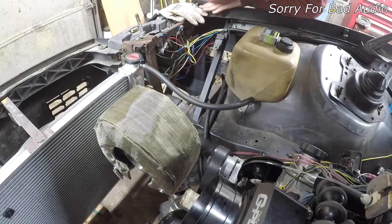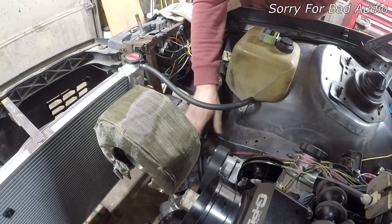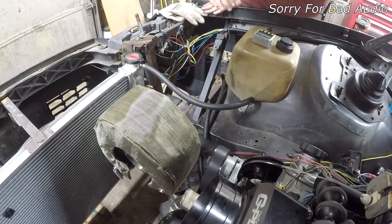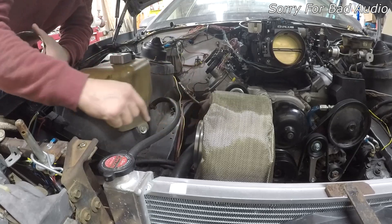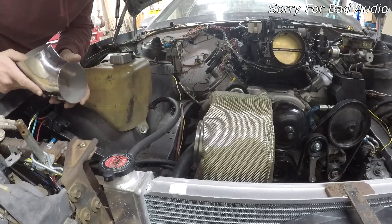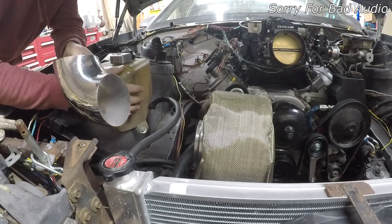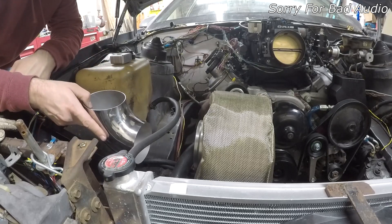Other than that, I think it looks pretty good. It'll tuck itself underneath the hood and we have lots of space down below. I think I have an idea for this hose — this is kind of in the way, I might snake it around here. Then maybe I'll just do an up pipe right there. This is a 4-inch elbow, this is a 5-inch out, but I have a 5-to-4 that necks down, and I'm gonna have a little piece of 5 right here and that's going to angle out to 3-inch going back. I think we can do a 4 just like that, heat wrap it, and hopefully this will be safe — otherwise I'll put some heat reflective tape on it.